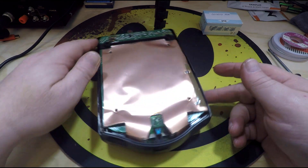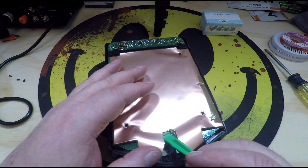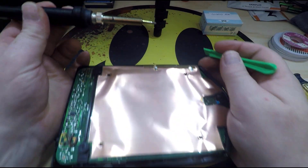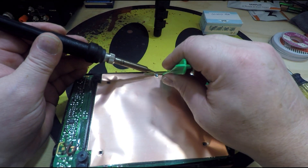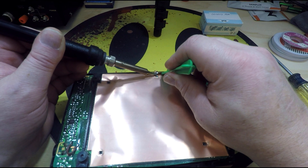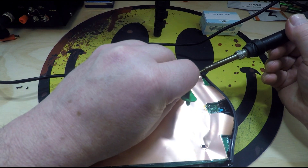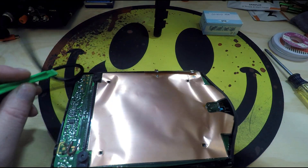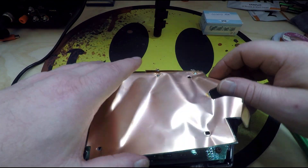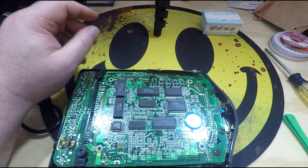As you can see, we have a crown shield on here. And it looks like somebody's had this open before because that solder point's not even soldered to anything. What we will do is go ahead and unsolder these. I always try and use plastic pry tools wherever I can — I just don't like metal laying up against and prying on anything. See, it just comes right off. We'll put that over there out of the way.